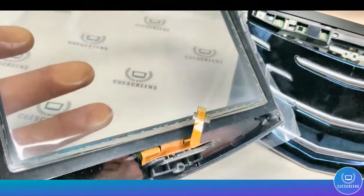All we have left to do now is tighten the remaining screws. As you go around the perimeter, you may notice some screws aren't fully exposed to the plastic mounting hole. If you can't get a screw in easily, just leave it out — most should align well. As a rule of thumb, if at least half the hole is exposed you can probably get the screw in; otherwise, leave it out and the screen will be fully secured with the other screws.